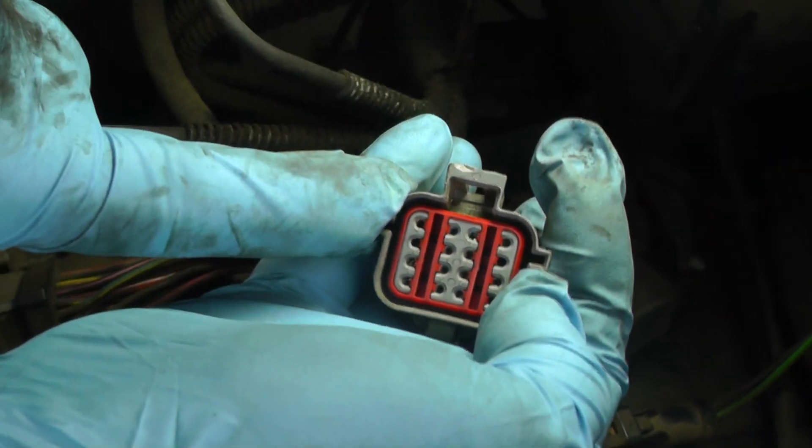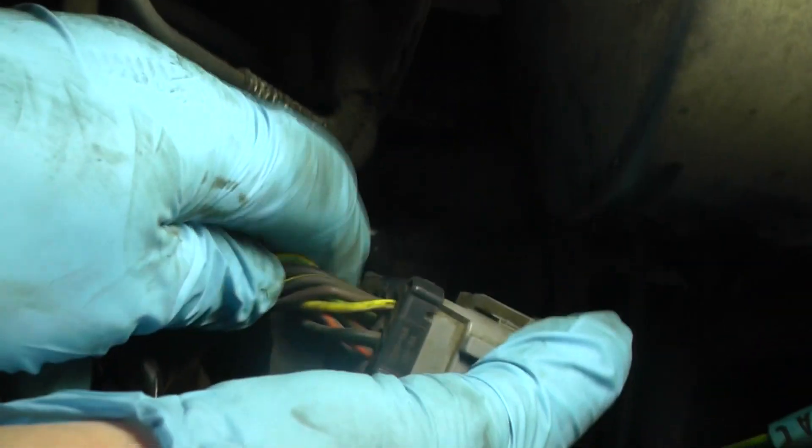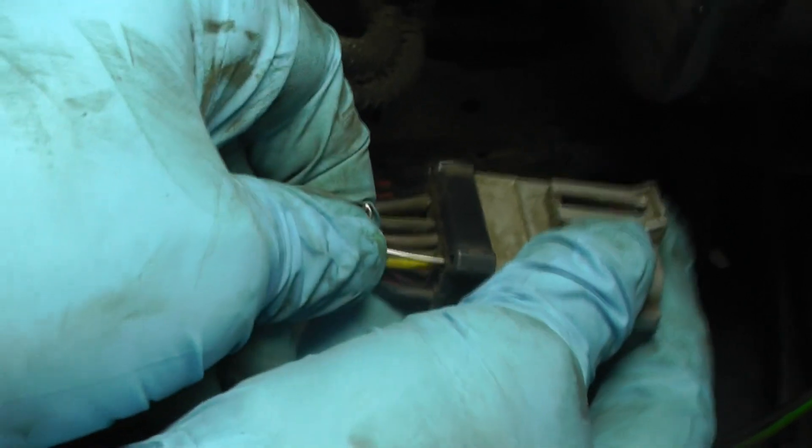There's a tab here — the female side tab housing is up on top. Pin 4 should be in the top left corner. Looking at it, it's a yellow wire, and you can see a little bit of a white stripe running down the side — you may not be able to see that. So let's get a T-pin and stab right down on the side of this wire. Okay, we're in there.